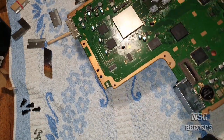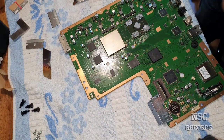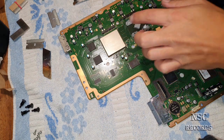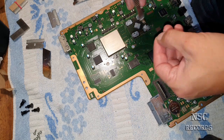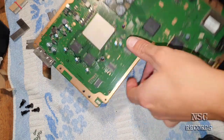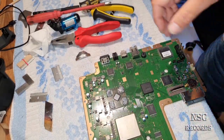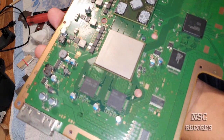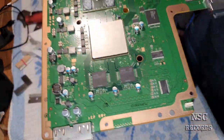But it's okay. So now, let's go for my favorite, also here on the CPU, the heat spreader. Just take care, they are way thinner than the other ones, and the place to get your tool inside is a little bit thinner than normal, okay? So, also here, some heat is going to help you because the silicone with heat gets really soft, you know? So, let me try to record this like that. Yeah, looks good. So here I'm going to be able to cut it.